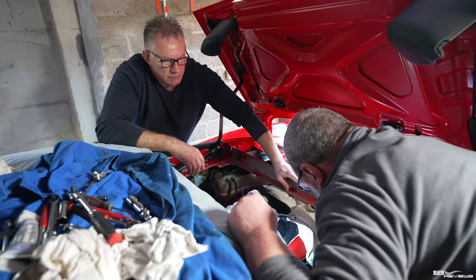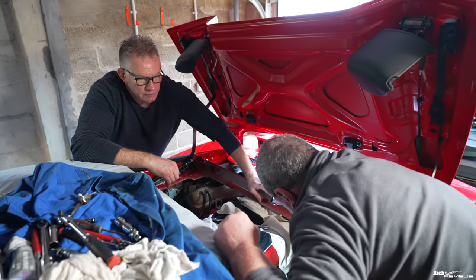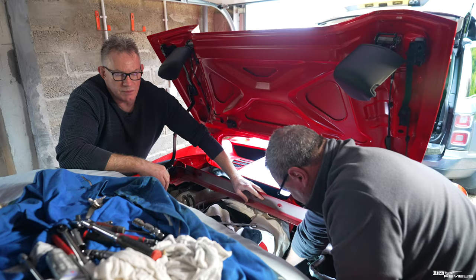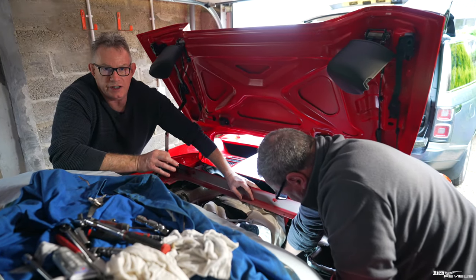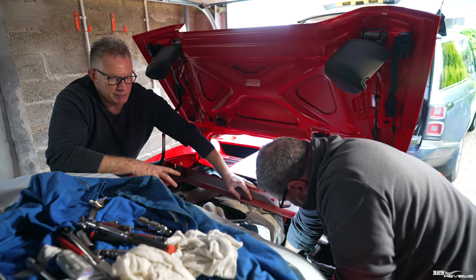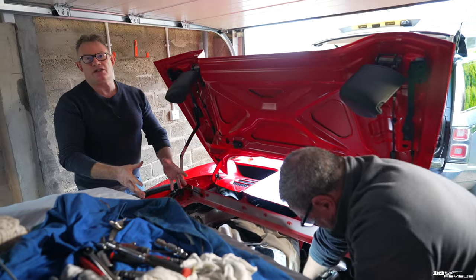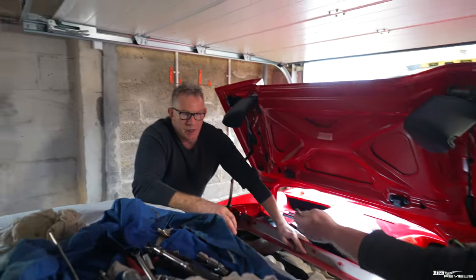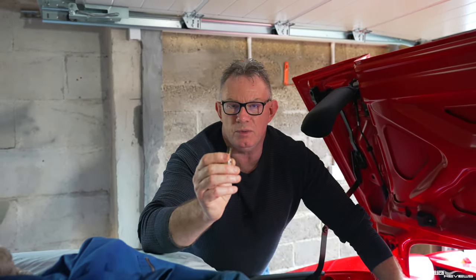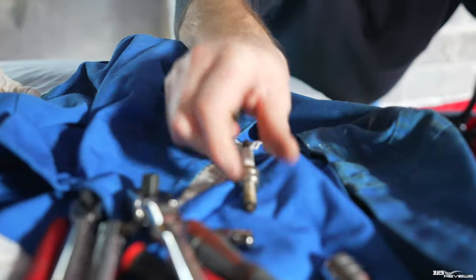It's reassuring they haven't been put in too tight — just over finger tight at around 15 Newton metres, which is plenty to seat the crush washer. They should be torqued to 15 Newton metres. The Ferrari mechanics who built this engine — and it was built on a block outside the car — torqued them correctly to spec. This engine hasn't been touched since the car was built in 2015, and we're also torquing the new ones back in at 15 Newton metres.